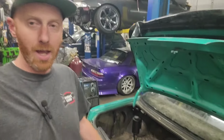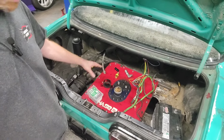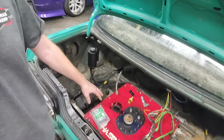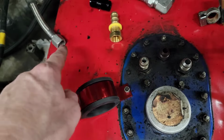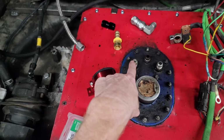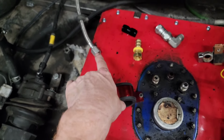We're back at it today and we're able to make some progress here. We got the tank in, got all the stuff cut and rewelded and everything fits. So now it's time to start figuring out some fittings. So I have a dash 8 here and a dash 8 there, but I'm running through a pump. So I'm thinking about running two pumps instead of a surge tank. So I need to do a dash 8 to a Y to two pumps, Y them back together, and then go into that dash 8 line.